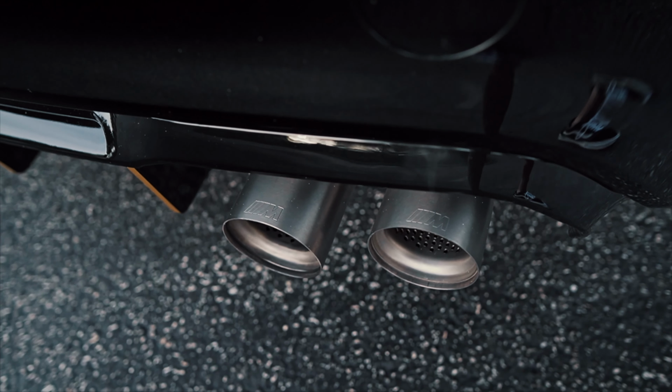Now, the only things left that we have to put in that you guys are going to be seeing in a few upcoming videos, we do have to put in a catalyst downpipe, and I also have a turbo inlet and a turbo outlet pipe. And I think after that, we should be pretty much full bolt-ons at that point. From there, we're going to go ahead and get the car tuned, seeing what numbers we're able to achieve with that setup. I'm hoping that we get something pretty good. And after that, I think we're going to go ahead and mess with some fueling options. And then overall goal, once this project is done, would be to go ahead and do an upgraded turbo.